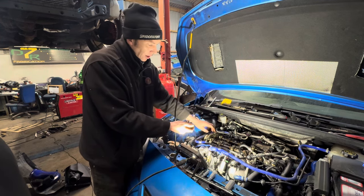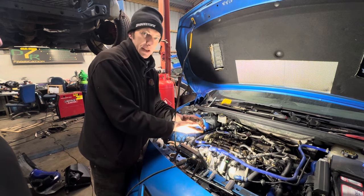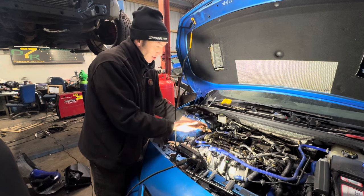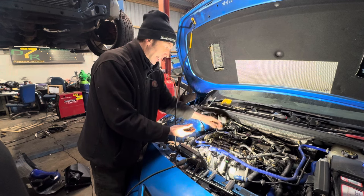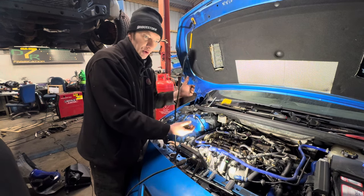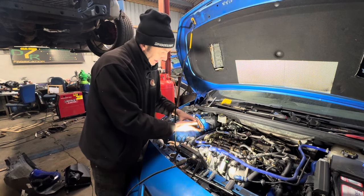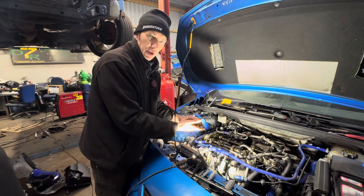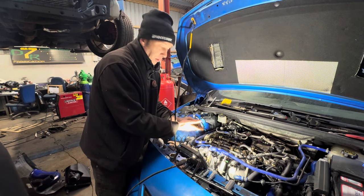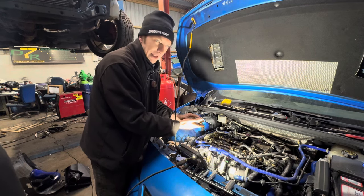So when we put it back into line again, we're doing this just to establish if we need to buy a chain kit, so we can run a proper compression test on the engine, because we know it's all in time, so all the exhaust and the intake valves are closing at the right time and not losing any compression. For the time being, we're just going to use the original items before we can tell the customer what's going to need to be purchased, so that we can then strip it down and replace everything that needs replacing.